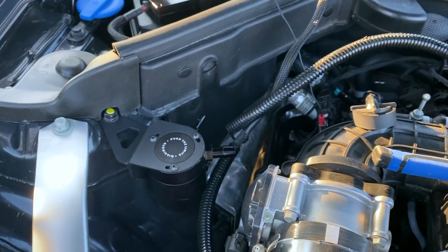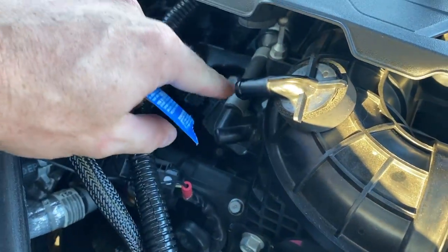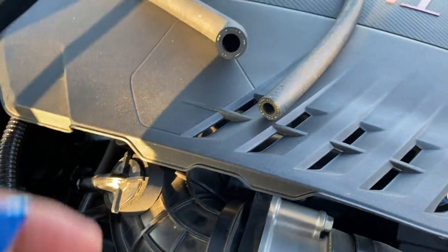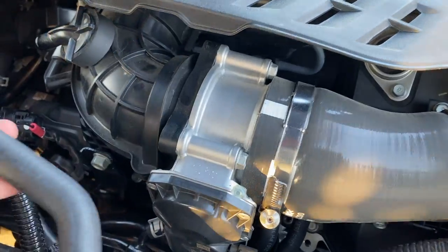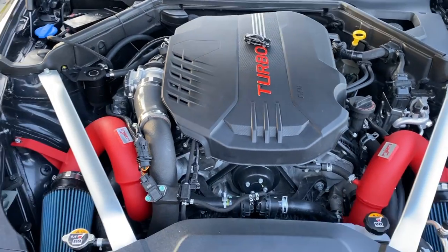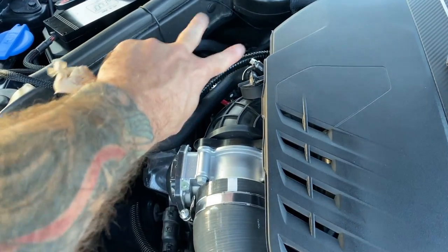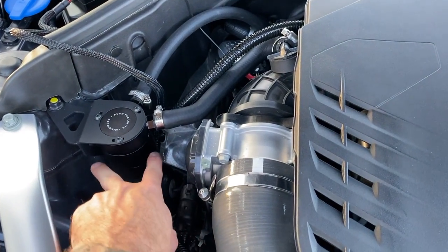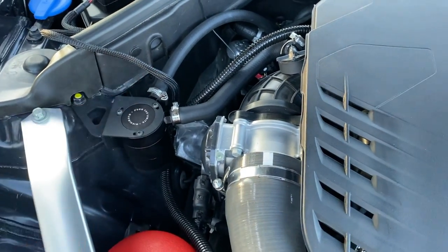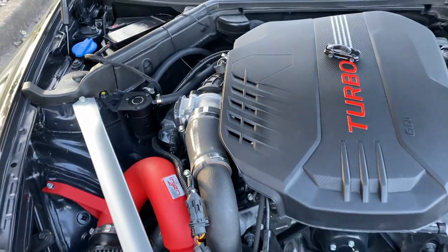I just finger-tightened these down for now because it looks like we have a little bit of adjustment room — I want it to be the most natural fit possible. I'm going to lube the PCV valve there and the one at the bottom, and also the ones on the catch can to make it a little bit smoother. Check this fitting out — they got that down to a science. The fitment's perfect. I do recommend leaving those hand-tightened once you get the hoses tightened down really good; this will just fall into place naturally where it wants to rest, and then tighten them down really good. Keep in mind they are 2.5mm Allen key, so you don't want to go too crazy. That's it — let's start it up.